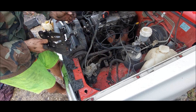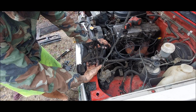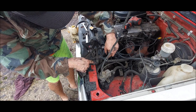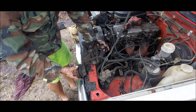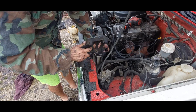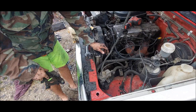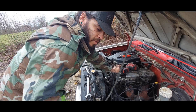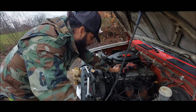The whole bracket setup is off. So to show you — you got two bolts on the bottom, two top bolts, two bottom bolts for the bracket — all 14 millimeters. And then this is your tensioner for the AC compressor belt. This thing's got some weight to it. Cleaned up the side of the engine some. I'm gonna be doing engine mounts on this thing soon — building solid mounts for it.